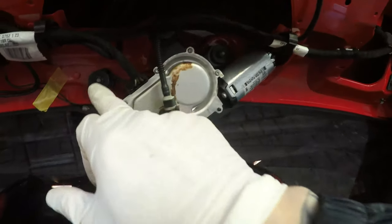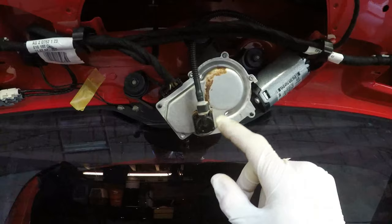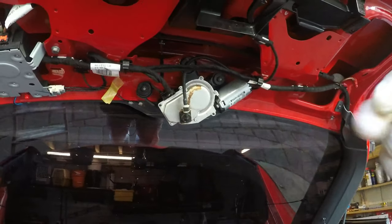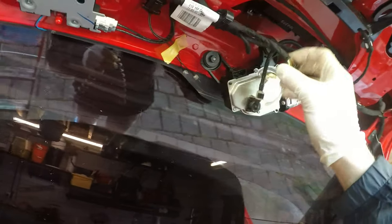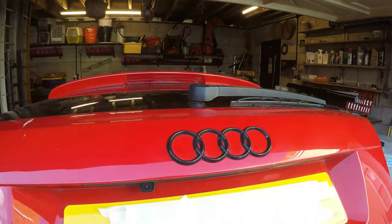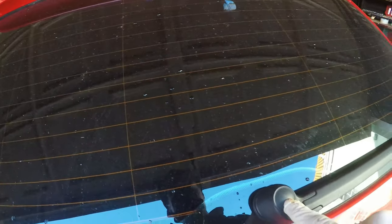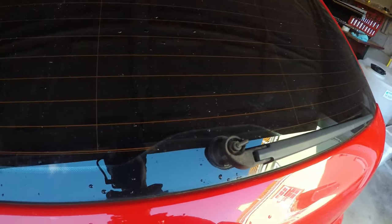I'm going to focus on getting this screw off. This looks like it's some sort of sensor — this is for the windscreen wash, which I need to take off. Apparently you can just put a bolt through there and put a cable tie around it and hopefully it will hold. I'm going to put a bolt in there, glue the bolt in nice and tight, and then put a cable tie on it. Now I need to take the rear windscreen wiper off. I think it's just taking that cap off — there's a 10 millimeter bolt there.